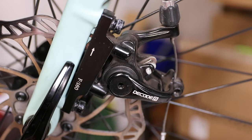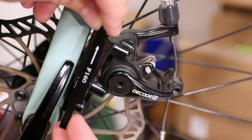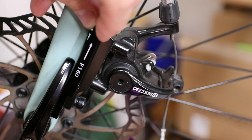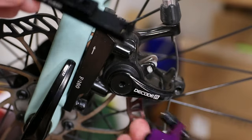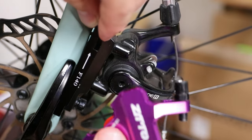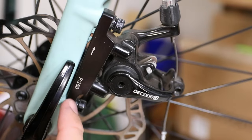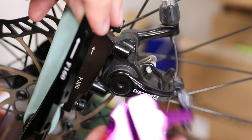For the front, this is the adapter plate mount. If you have 160mm rotors, you mount it like this. On the other hand, if you have 140mm rotors, you flip this mount over, and that brings the mounting points lower to adapt for the 140mm rotors. We have 160, so it goes like this — same as the original. The new adapter is a bit different shape and quite a bit thicker.